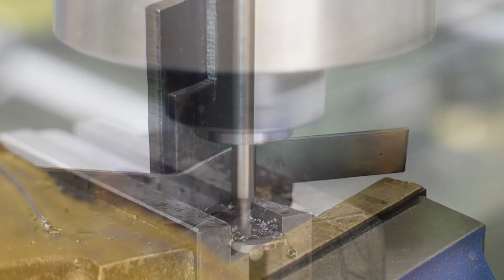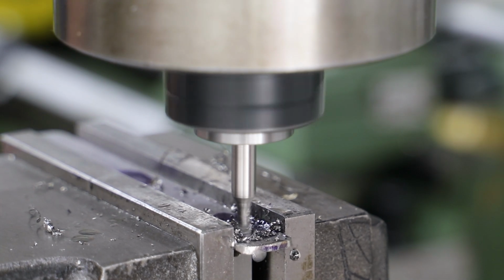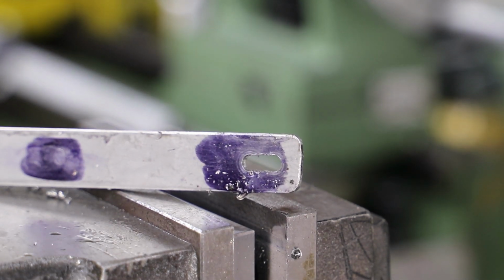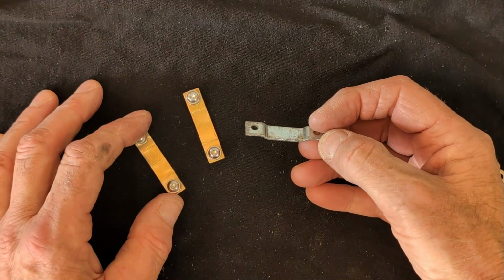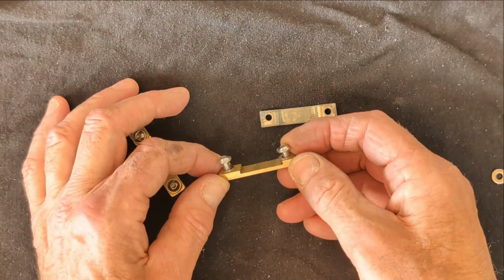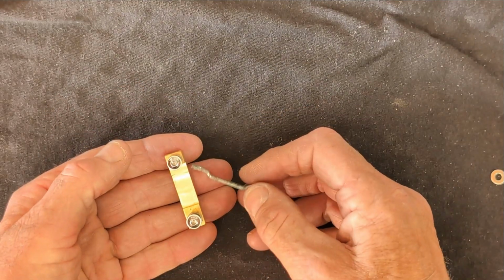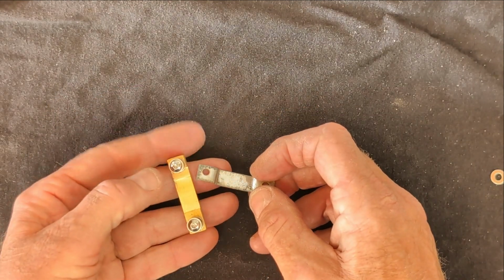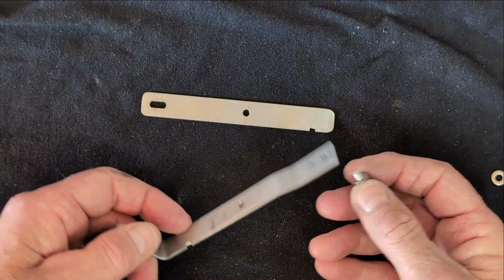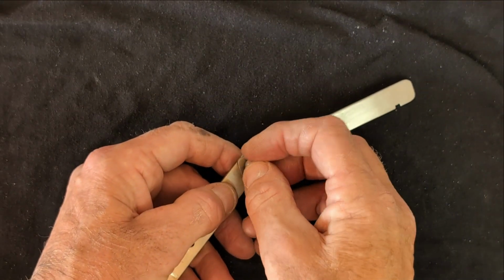Each part has a pivot hole and a further hole in one part and a slot in the other for where they connect. In what will now likely become the most over-engineered part of the restored bike, I make a couple of brackets from brass to replace the original parts, and rather than rely on rivets, I thread the brackets and use stainless screws throughout. To connect the two parts of the latch together, I use an M4 screw, a couple of washers, and a nylock nut.